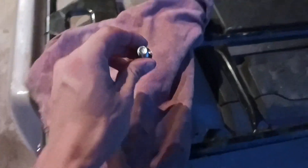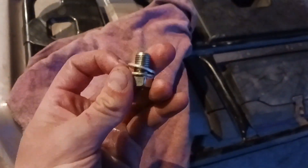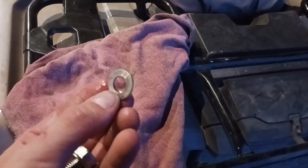Once we got that broke loose, this is our oil catch pan. We're gonna go ahead and unscrew that slowly. I'm gonna drag that pan over and have my finger — I'm undoing that bolt right now so I can catch that bolt and let the oil drain. There's the bolt. Now that we got the bolt out, this washer is technically a crush washer — you can see a little bit that there's a ring around it that's been crushed.